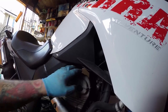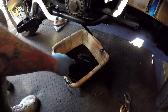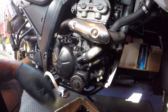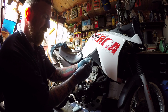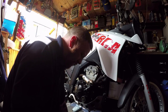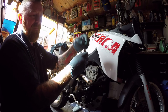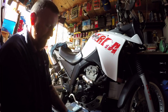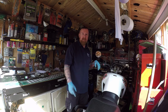The plug is in here, so you need to get the tank off - almost certainly some plastic panels too. Anyway, let's clean up. The old dirty oil out, some nice proper oil in - check the stats, I think it's 10W-40 or 5W-30, but check the right oil for your bike. The plug was in here like I thought - not a bad plug, but I'll get another one. It's a CR8EB, small port. You basically pop that in down there, undo it, lift it up gently, pop it out, and then take the rest out. I will buy another one - it's on the agenda.